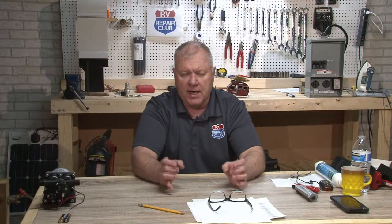And most of your chassis manufacturers, your RV manufacturers, don't recommend the wheels coming off the ground just because it's just not quite stable enough with the smaller jacks we see today. In my opinion, what I've always done is I've carried some leveling blocks with me. Once it levels, I go in underneath, manually raise it a little bit higher, put the blocks in, and bring it down and rest it on there. Then I'm not relying on that front jack.